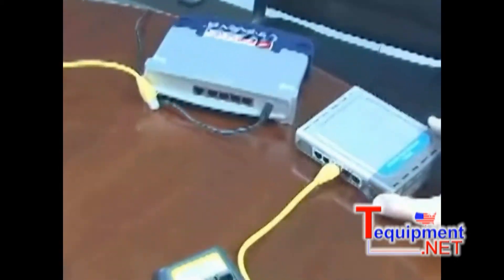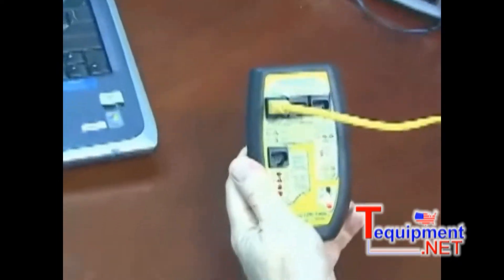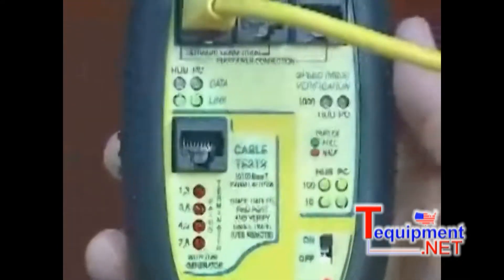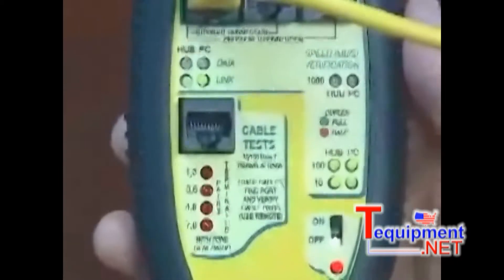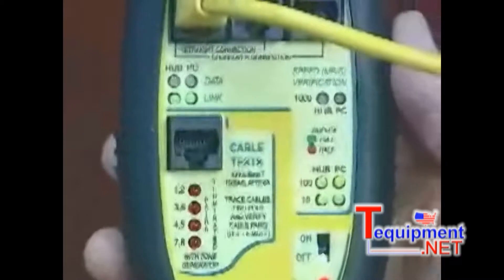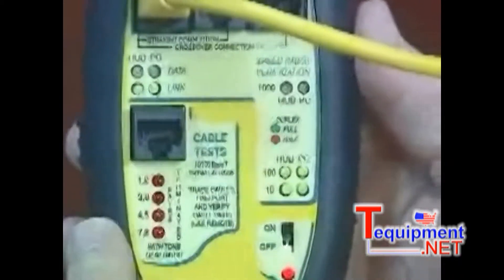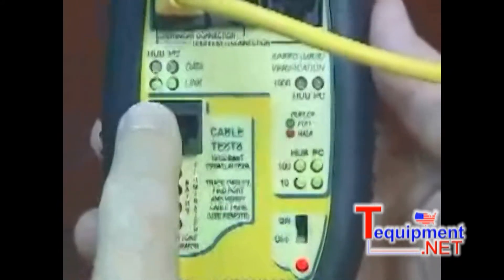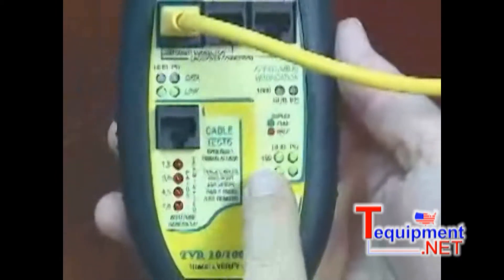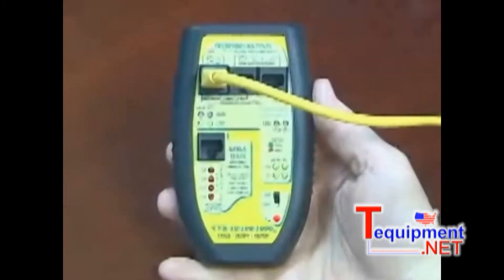Now let's go over here. We have a D-Link switch — let's see what kind of switch this is. Bear in mind, these switches could be remotely located and you're plugging into a wall socket — you'd get the same results. The TBR1000 is telling you that this D-Link is capable of creating its own auto-crossover cable. It can either be a straight-through cable or a crossover cable, and it tells you that by saying it's capable of configuring itself as a hub or a PC. The D-Link switch can communicate at 10 and 100, and it's capable of full duplex — that's what the green LEDs are all about.